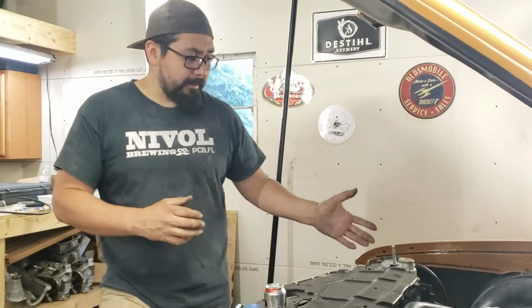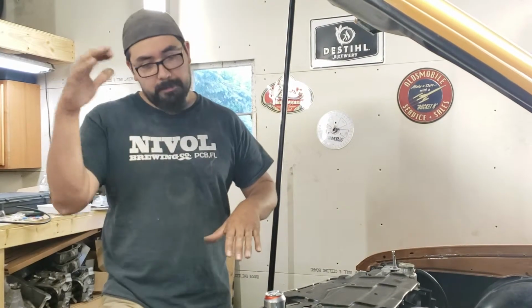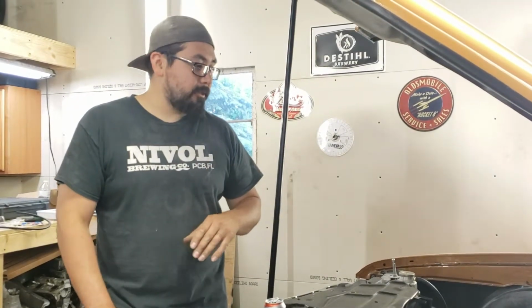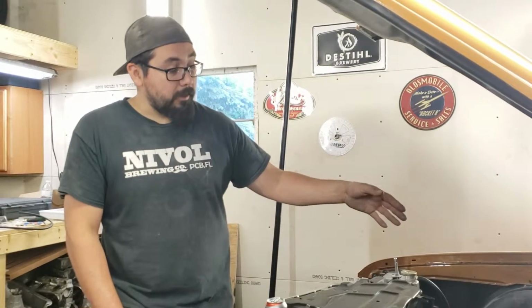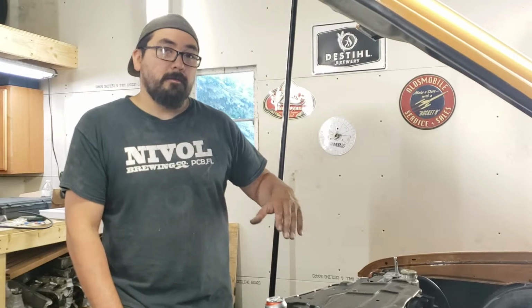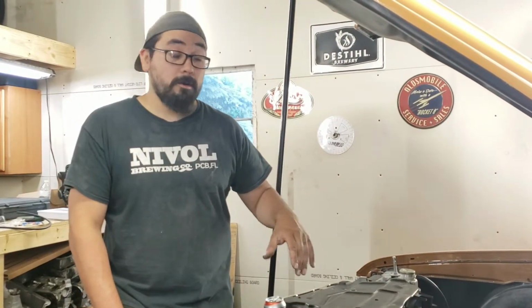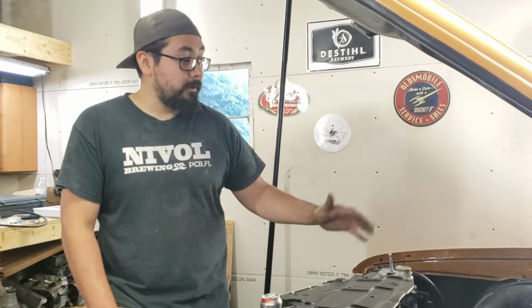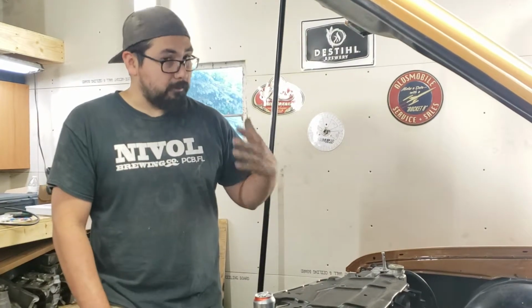For the timing chain, I got a Cloyes True Roller double roller, not their cheap one, not their expensive one, right in the middle. It degreed pretty good, a little off, but managed. The intake is a Holley Strip Dominator, which was milled, with a spacer welded on to convert it from a spread bore to a square bore, and we got a Super Sucker spacer in there. Topping it off is a 750 HP carb, which I'm still working on.